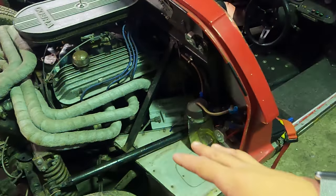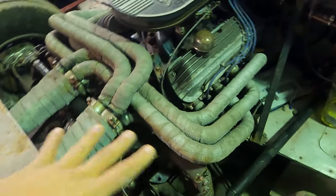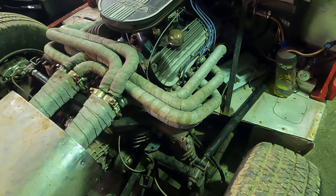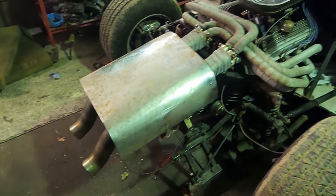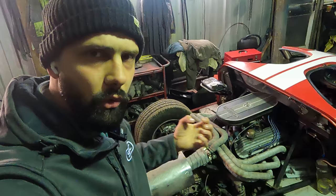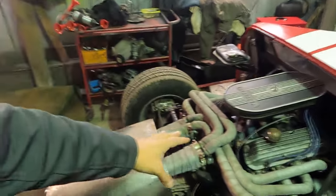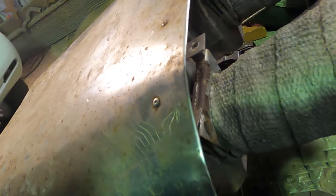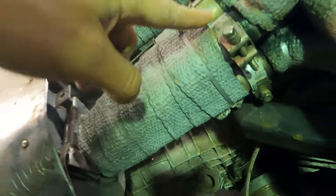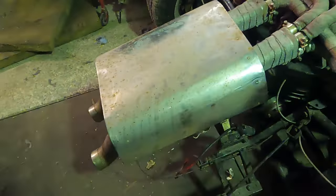The exhaust, made out of stainless steel, is fantastic. I'm not sure if the diameter of the pipe is correct, but that's something we can maybe improve on — we could make it bigger. What I've noticed is Ivan has made a crossover exhaust. This car, initially as a Mark III GT40, would not have had a crossover exhaust. But this is the part that makes it sound like a supercar, as opposed to a V8 Corvette rumble. He's done four-to-one collectors, which are separate — you can remove this part by undoing the clamp and four bolts. These are really, really nicely done in stainless steel, so it doesn't corrode. The heat shield is brilliant and does the job, but we will be making something a lot more pretty.